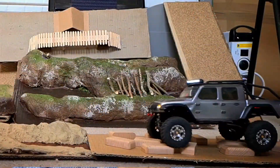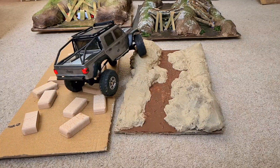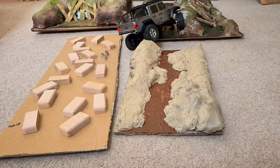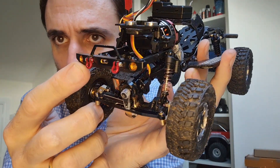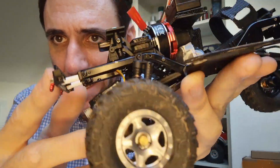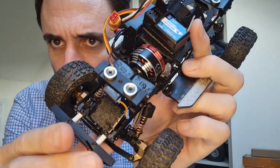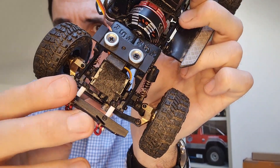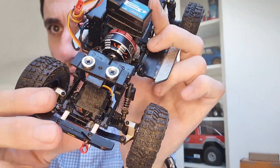With the modification of adding some green slime inside to make them damp, they now damp really, really well, as you can see in those videos — I think it performs the best this way. I also have this custom fender with the golden trim — I didn't notice it was golden, I prefer the normal metal ones. I had to make my own styrene rods here to position it because now it's not interfering with the servo when it goes up and down. I had to trim and make a custom support for the fender, but now it works really, really well.